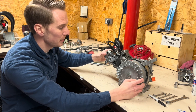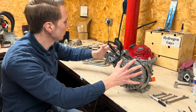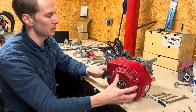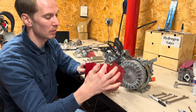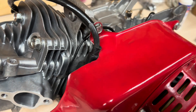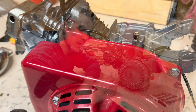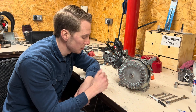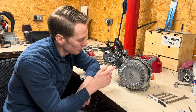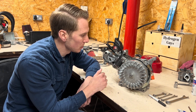This should give me a nice clean setup. I can put the original shroud back on the engine now like so. All you have to do is have a small cutaway around the shroud to allow for this coil to be moved up, otherwise it would hit the metal here. To make this bracket, all they used was a piece of aluminium, shaved away some material on the coil pickup legs here, and it would bolt straight on.